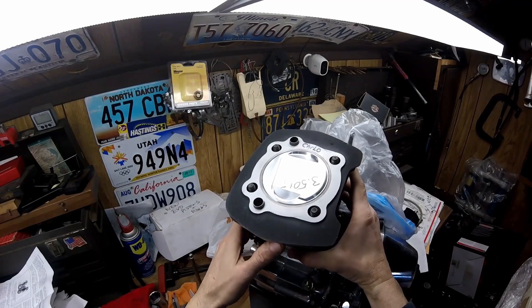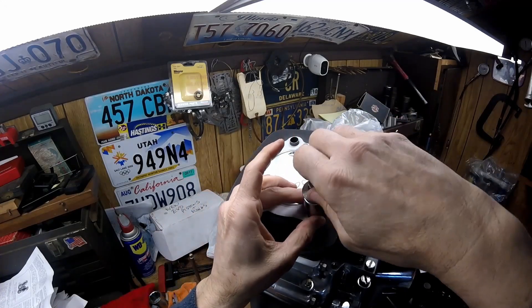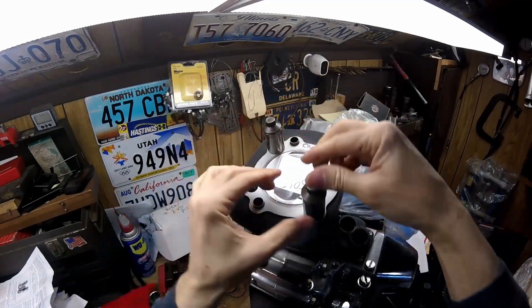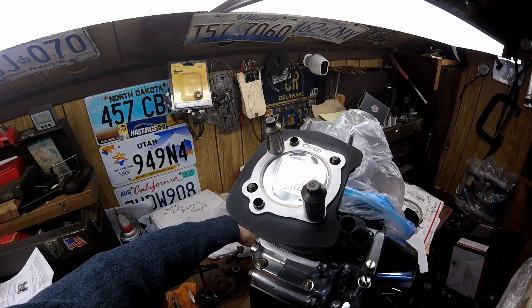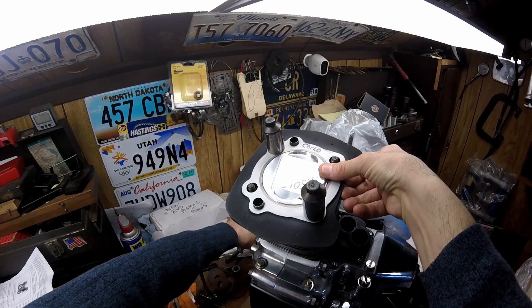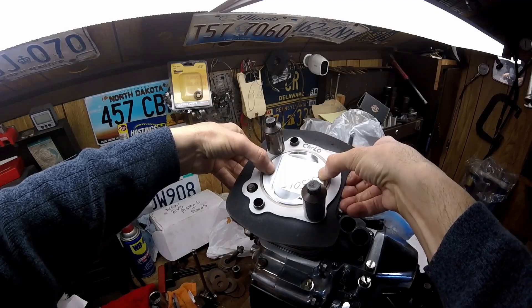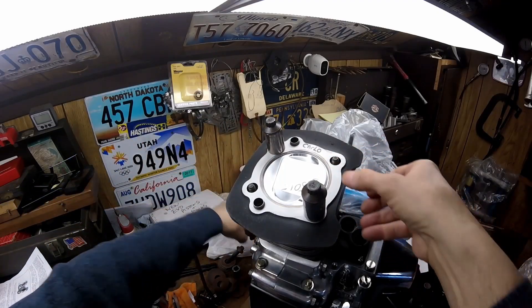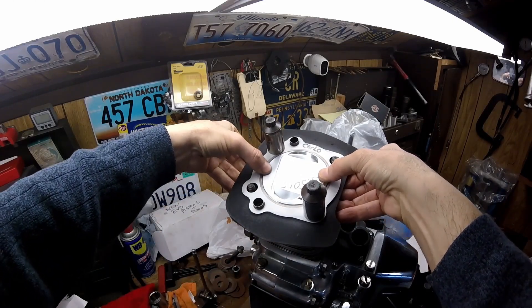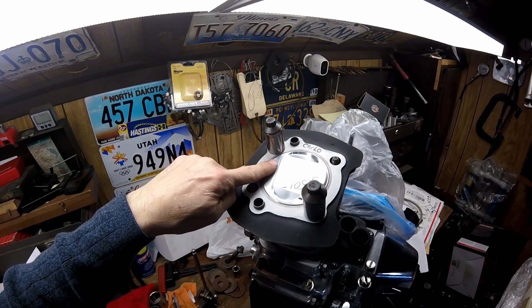I get a half-inch drive socket and the shorter head bolt and snug them down. Then I eyeball top dead center — you can eyeball it while keeping your finger at the top to feel right where it hits TDC. Nine times out of ten, once you're at top dead center you can't push the piston into the bore. With no rings you can almost feel it on the crankshaft — that's top dead center.